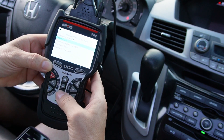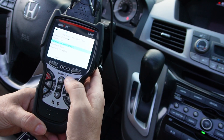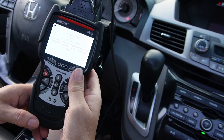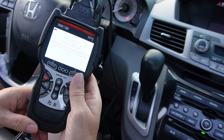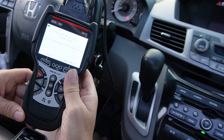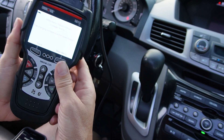Now I want to test the alternator. First let's do battery live data — battery showing 13.5 volts, that's good. Let's do an alternator test. It says turn on headlights, increase and keep the engine speed at 2000 to 3500 RPM. Turn off headlights. Alternator status: good. The charging voltage is within specification. My other scanner definitely does not do this, so I'm very impressed. It's really nice and very easy to use.